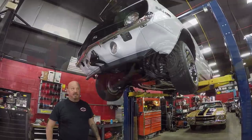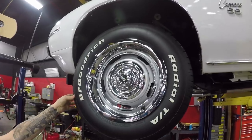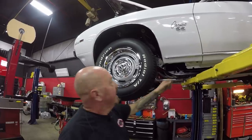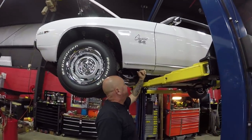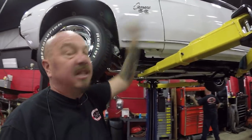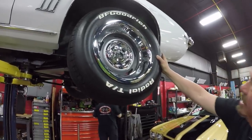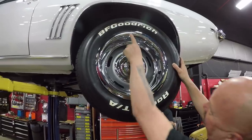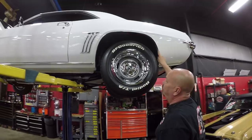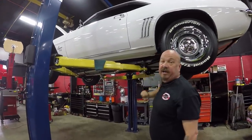Now let's look at those wheels and tires. Up front we've got 215/70-15s — they look like brand new BFGs, brand new center caps and trim rings. Trim molding here looks good, and I always check inside here — reach around up there and make sure there's no unwanted patchwork. Everything looks good and tight. Out back we've got 295/50-15s — that'll get you some traction. We've got new lip moldings here and paint work right down to the bottom edge. Beautiful, and those rockers are solid as a rock.